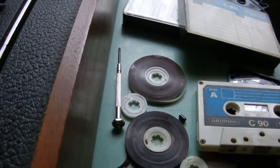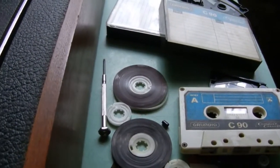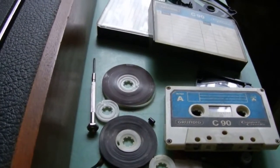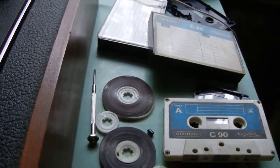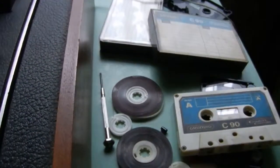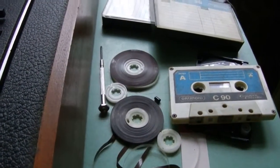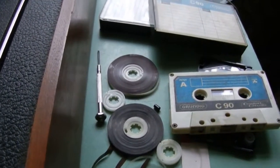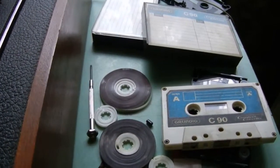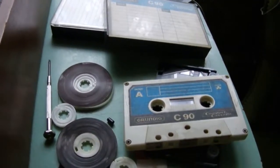So, yeah, I've seen that on videotapes, because not too long ago somebody made the mistake of trying to play a mouldy video on their machine, and let me just say it took a wee while to clean out the tape path and the heads and everything else. Yes, nothing minor, but slipping the innards and the tape from a newer tape, which was in pretty shitty condition casing wise, into the Grundig has brought it back to life.